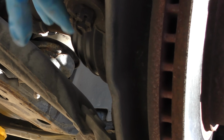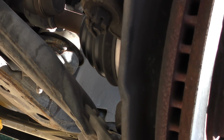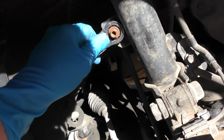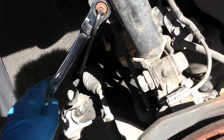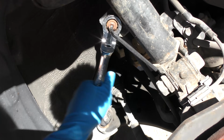We're also going to take off this key and take the tie rod arm off so we have more working room when we're doing the job. Now you can see this nut here is tricky. It spins. So what you do is you put the wrench on here first. See how it just spins? Stick an Allen key inside. Then as it spins, the Allen key hits here and watch. Voila, it comes off. It's tough if you're not using one hand to hold the camera and the other one to use, because you need two hands to hold both parts.